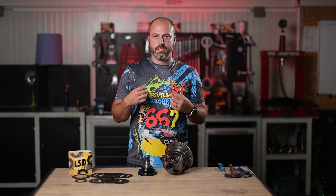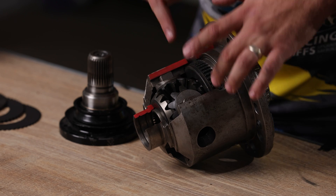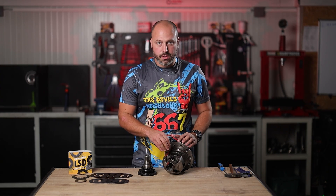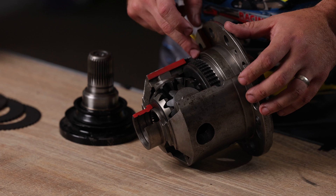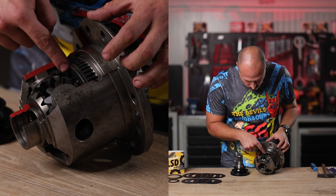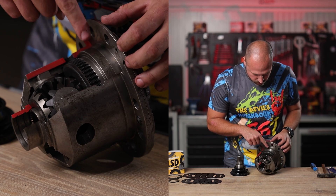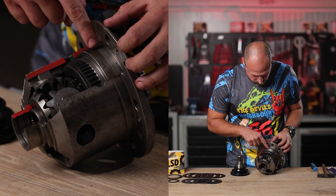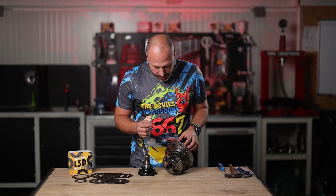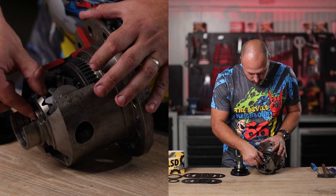To describe that as best as we can, we had to cut out one E46 M3 differential. The M-clunk is coming from inside of the LSD unit. You can see here in this section the internals — one large spider gear, the other one connected to the clutch stack, and here is the visco pump which adds a bit of progressive response inside this differential, and a significant free play can be spotted right here.